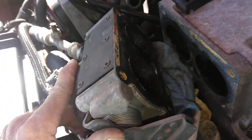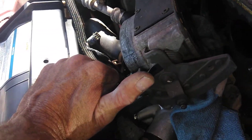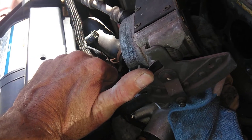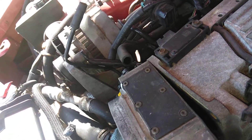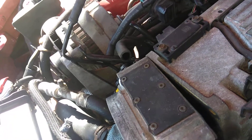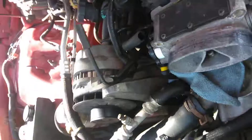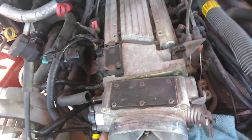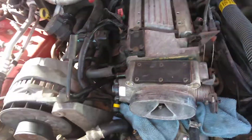So this is what I'm doing. While I'm here doing my 58mm throttle body, I'm also going to do the coolant mod. Because why run coolant through the throttle body? It's just going to make your temps higher — your intake air temperature is higher. So I'm going to run no coolant. There's going to be nothing coming out of the other throttle body — it's just going to be plugged off. This hose is going to now go to the other passage, to the pipe right there. Both passages here and here are going to be left open on the other one. There's going to be no coolant going to the throttle body — it's going to go directly from there to there, and that is the mod.